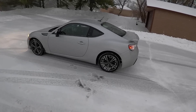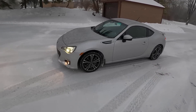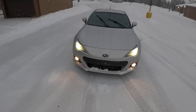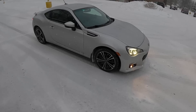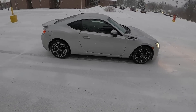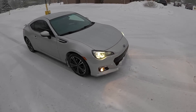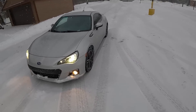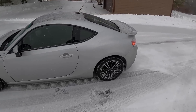It finally snowed here in Michigan and I have a new winter setup. I bought a set of Dunlop Wintermax tires on Craigslist for a couple hundred bucks and I'm running the stock size again, so back to 215/45/17 on the winter. I sold all my 16-inch wheels and wanted a little bit more of a higher performance setup for the majority of the winter when we don't really have snow and it's mostly wet and dry. So I wanted to test how this OEM sizing works.